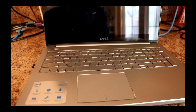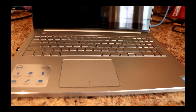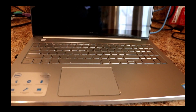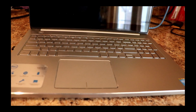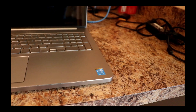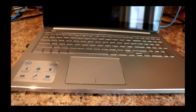That's the biggest lesson for the community, especially if you have a Dell Inspiron 15 7000: you have to remove the center cover and oil the hinges, or you're going to have a hinge breakage issue. And once they break, you have to put the bolts all the way through if you want a lasting repair.